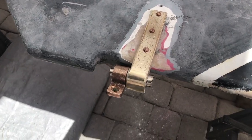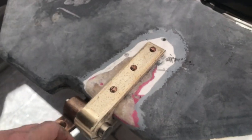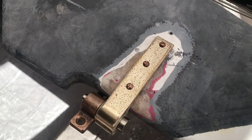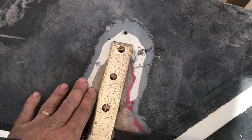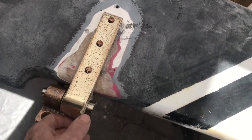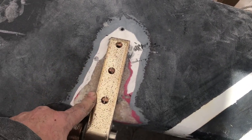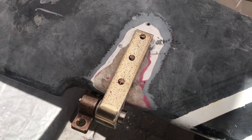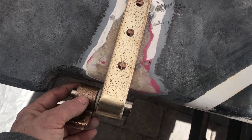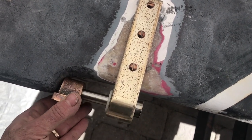Now I've shaped that gudgeon - very, very heavy duty. Sanded it down, polished it up a little bit. Not that it matters, this is going to be underwater. As you can see, I had to sand down some of the gel coat, barrier coat, then gel coat, then fairing. But I got it to fit really nice. Drilled some holes for dry fitting - these still need to be over-drilled and epoxied. And then just fitted it so that if I ever did ground out and the rudder had to come off, there was room for that.